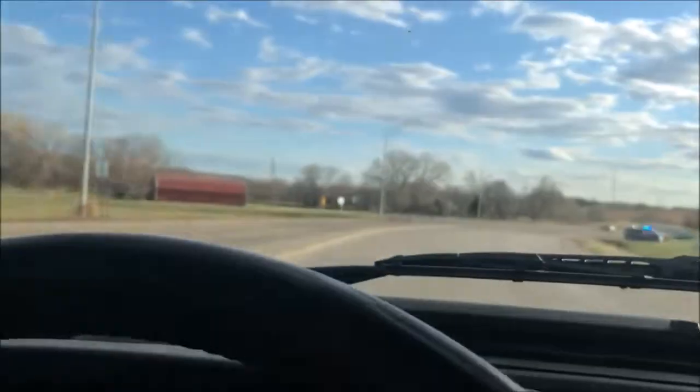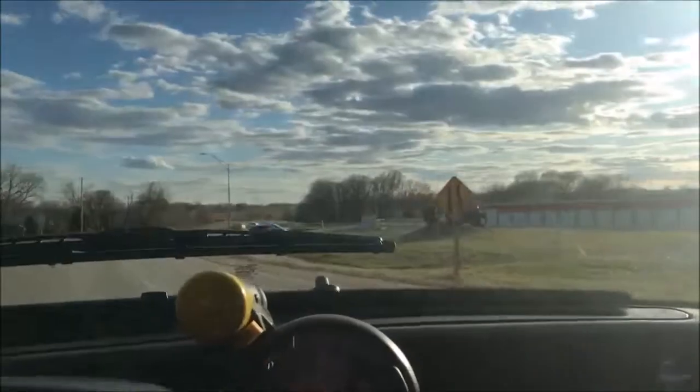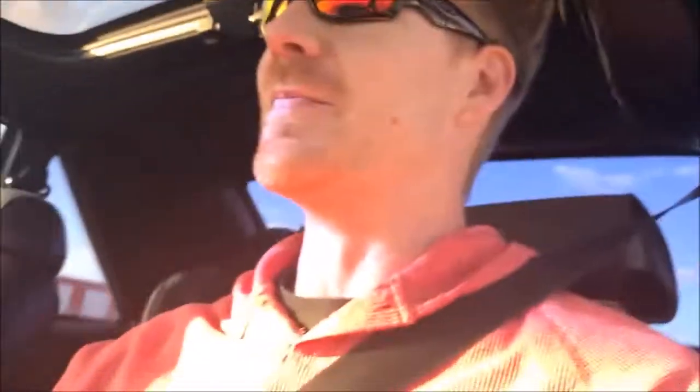Everything's come together and it just feels really stable up top in the higher RPM range. Before with the E7s, I don't think I had my valve spring setup properly — I don't think installed height was good — because it always felt like the valves were floating at the upper RPM limits, which would explain the power drop as well. This setup is just better overall.